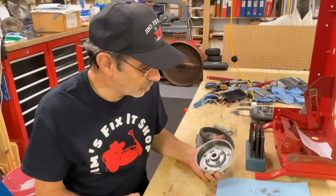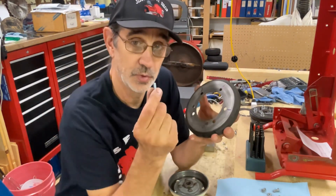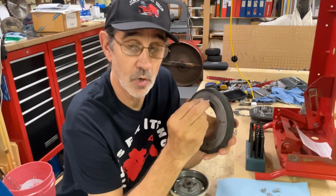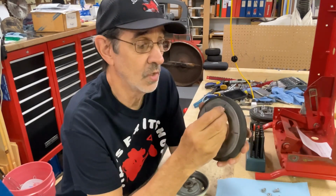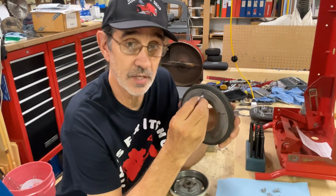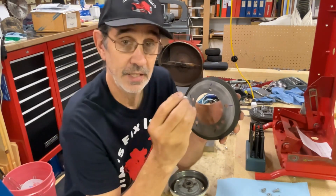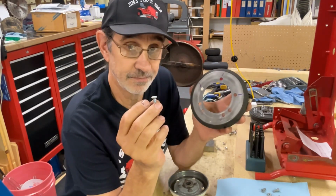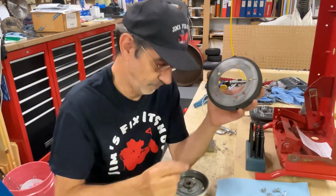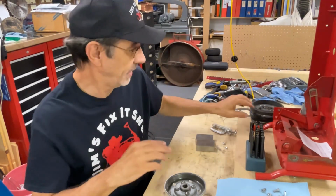But you can use 1/4 inch if you want to. The only problem I had in the past with using 1/4 inch screws in these 5/16 holes, these are already drilled. This thing will start, once these loosen up a little bit, this clutch disc will start chucking back and forth. And it will continue to do that until it breaks these screws in half. Then you're going to stop. It kind of messes up these holes, and it messes up these holes. So I just went to 5/16, and I don't have a problem.